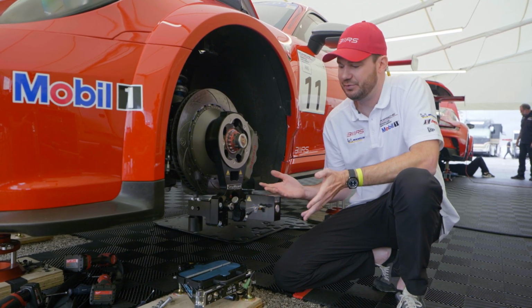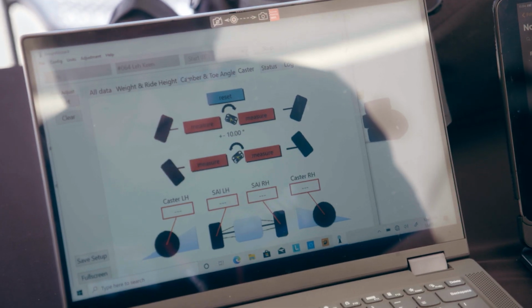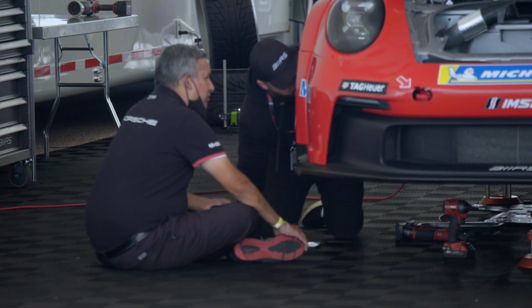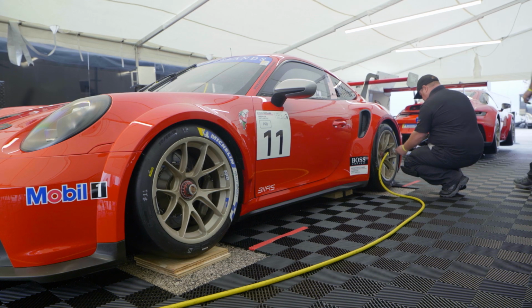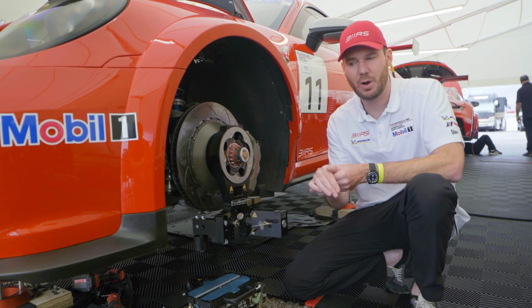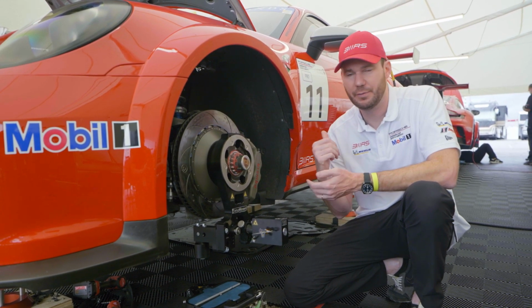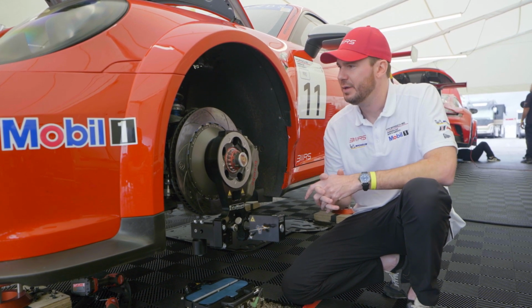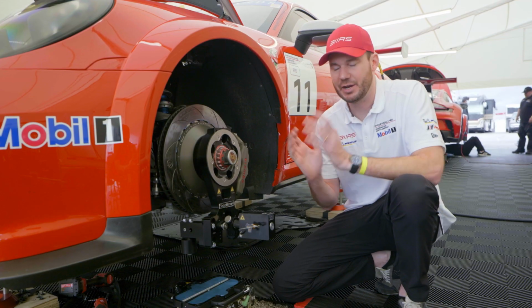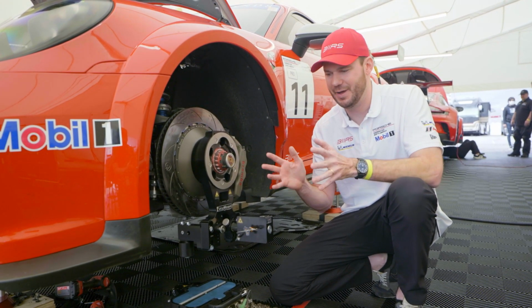So as far as setting up the cars, we have maximum camber limits, toe limits, ride height limits, things like that, and that keeps us in the regulation. But we have sway bars, we have all those other elements that I just mentioned, and that completely changes the way the car handles. If we have push, we might want to lower the nose a little bit or soften the front bar, try to get some more weight on the nose to help turn. If we have oversteer, we can add wing, soften the rear bar, move things around. Maybe you make a turn, which is about 1.5 mil lower on the shock perch. That actually will change the camber as well. So as soon as you move one thing, other things counter effect and move as well.